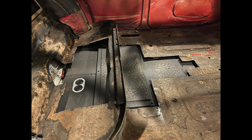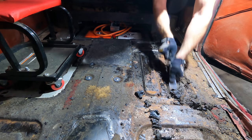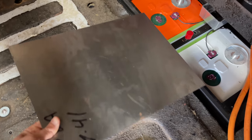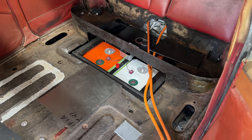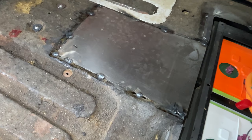There are four things here — actually five — so let's break it up into smaller bits. First, we have to bond in a panel to close out this part. Then we need to make removable panels for the two openings. After that, we have to clean off all the crap from the floor and level out the depressions so it's flat, and then paint it. For the closeout panel, I didn't want to weld it because it's sitting directly atop a giant high-voltage battery, so I used some 3M panel bond. I painted the bottom of the sheet of steel except for the outer half inch where I put the panel bond. It didn't work — my half-assed cleaning was not half-assed enough — so I just welded it carefully and only in a few spots. The car did not catch on fire, so I think we're good.